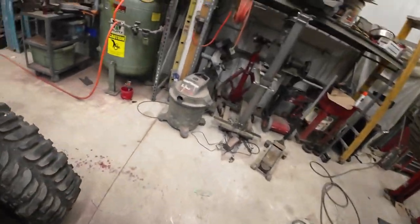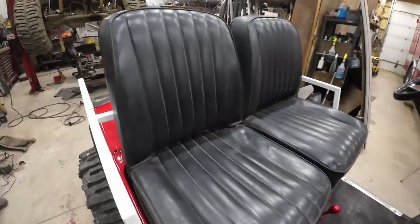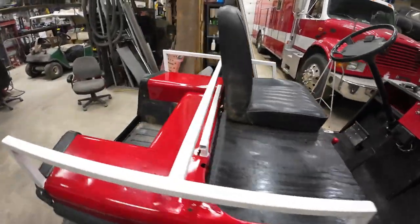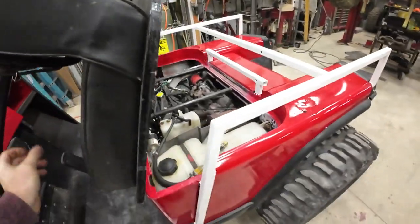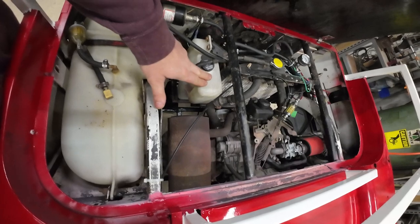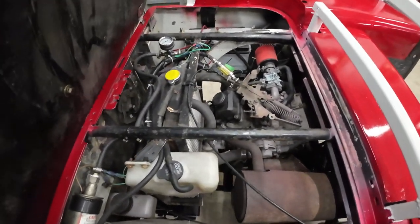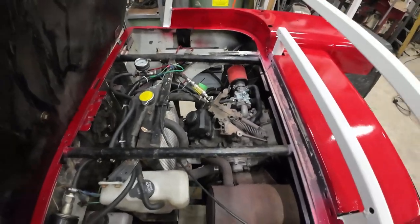Does really, really good. Comfortable driving, not big and crazy. Smooth riding with nice Jeep seats. I've got this seat so it comes out easy, and then I can lift this. Everyone likes engine stuff — got your factory gas tank, a little fuel pump, the engine, coolant reservoir. There's the master cylinder right there. Radiator. This is the Kawasaki 617 Gator Motor — twin cylinder, fit in there like a glove. Got a car battery in there, little air cleaner.